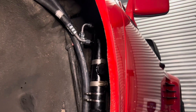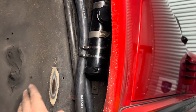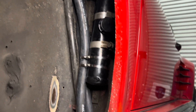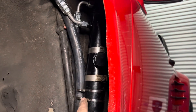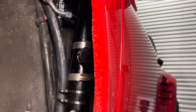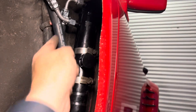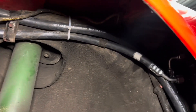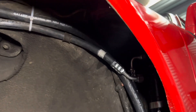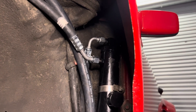Looks like we have some success. I was mostly worried about the tire coming back and rubbing, so I did add a little extra. As a Porsche friend of mine, Rob Van Name, likes to say: if you're going to zip-tie it once, you might as well zip-tie it twice — but these are stainless zip ties, they shouldn't be going anywhere. This is your pressure hose — the big one — so we routed him up as high as possible. The other is still a pressure hose but the small one, so he's on the bottom. Dryer is tightened down.